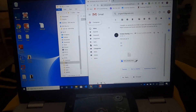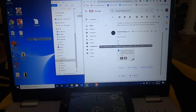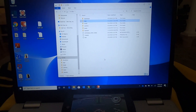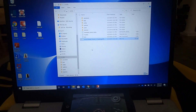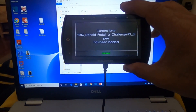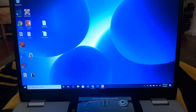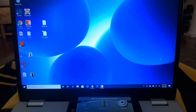All right, I use Gmail. So typically here's what a log will look like — mine's coming from Jay Green. I just quickly drag and drop the tune onto my desktop. You'll have to go back to the top folder of your T2 or your i3. Once you're back into this view, all you do is take the tune, drag it over, and drop it. You'll see it come into the folder and then it'll disappear. It'll say your custom tune and the name of it has been loaded — hit Continue. It'll close out and come back up, and then your tune is now in your tuner. The next step is to take your tuner out to your car and install the tune.